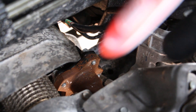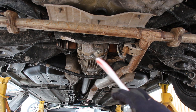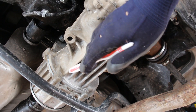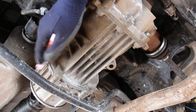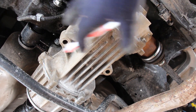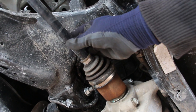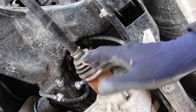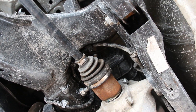From the top you can see the flange coming off of the transfer case, and that drive shaft is going to come down to the back here to the rear differential where it's going to split off to both rear wheels. Now while most vehicles control their all-wheel drive system up at the front in the transfer case, this vehicle controls it out of the back here, electronically controlled before it goes into this rear differential. Judging by the size of this rear differential and how tiny these CV axles are at the back, this isn't really a serious all-wheel drive system — it'll just be good enough for you to get out of that snowbank you just backed into at the shopping mall.